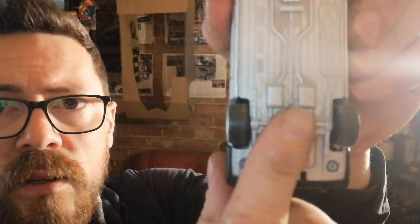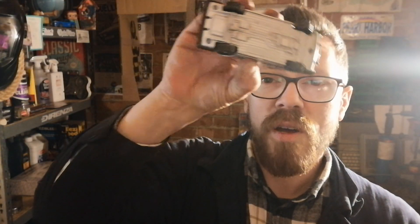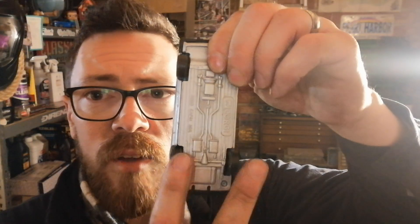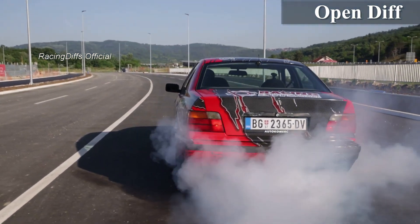If you're not sure what an LSD is for — we have a Capri, we have the axle and the diff. Inside here is an open diff, and the job of this is: if you imagine your Capri driving around a corner, around a roundabout, this inner wheel will be going slower than the outer wheel because it's got further to go. The open diff allows these two wheels to travel at different speeds, which you need — but the problem with an open diff is all the power and torque goes to the wheel with the least grip. When I launch my Capri on the drag strip, I can almost feel it all going to one side and it bounces, skips, and does all sorts of horrible things.